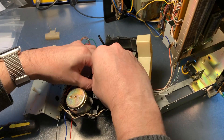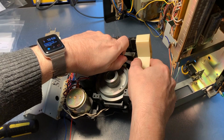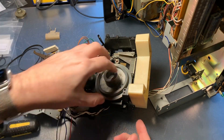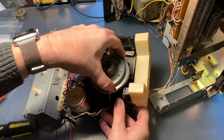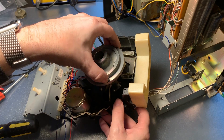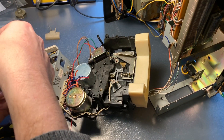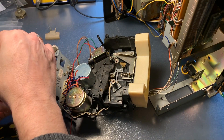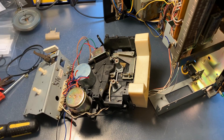When restoring a cassette deck like this I also like to remove the capstans — that makes it a little easier to lubricate and clean them. What you have to be careful about is that when you pull them out, on the other side there are some small plastic pieces that keep the oil inside. In this example they just drop onto my rubber mat below, so you just have to be conscious to collect them and put them aside. Alternatively you can remove them from the front before you pull the capstans out.